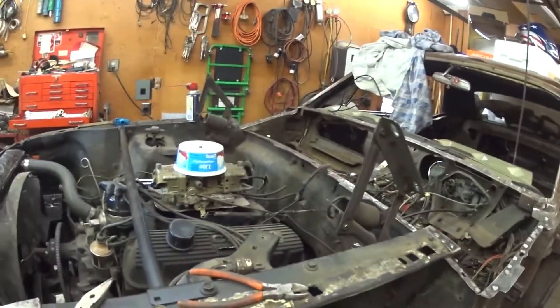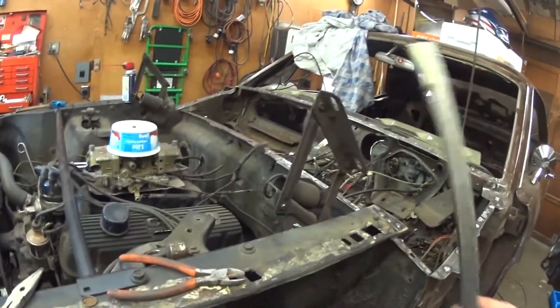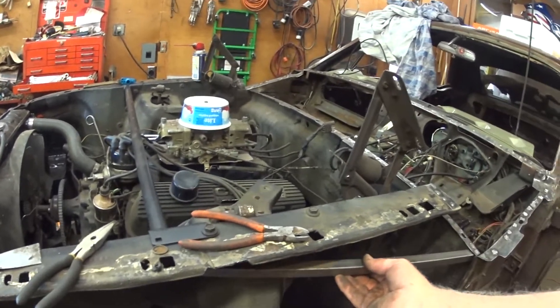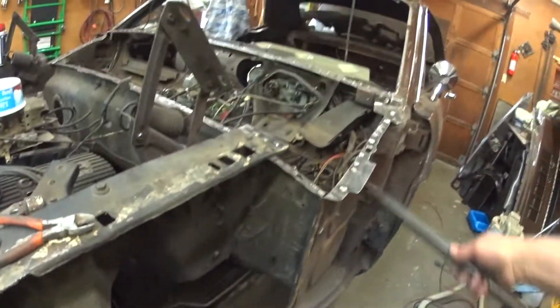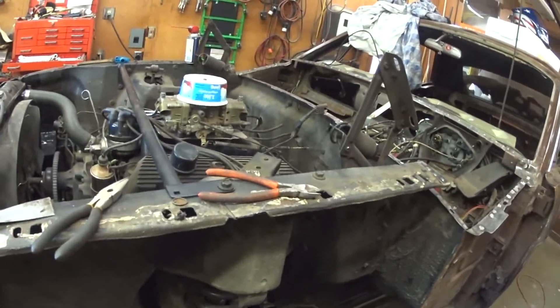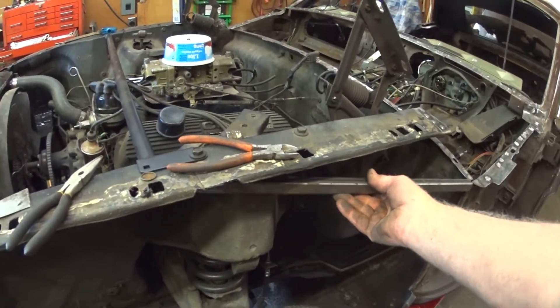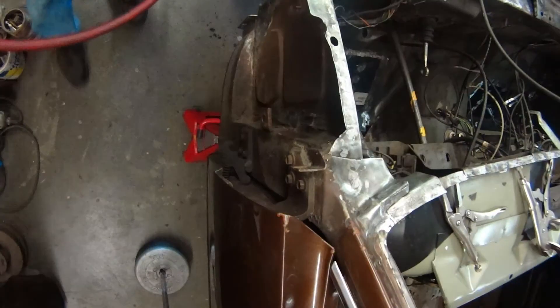I'll be triangulated between the Monte Carlo bar, across to the other side, and the export brace. That should really stiffen up the front end. I'm triangulating the whole front end with a part that's going to be sort of invisible in here — it just bolts in and bolts out for suspension work when needed. The export braces will be welded in as part of the body and completely hidden by the fender.